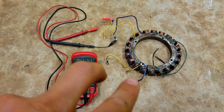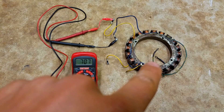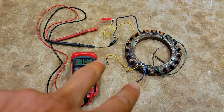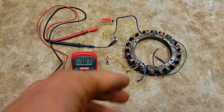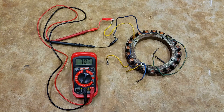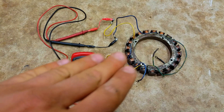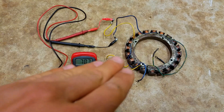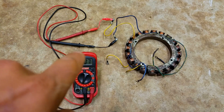Now we're going to test the other coil, and then we're going to test the charging coil with these two leads. We hook these two together and test that coil now that we know this one's good. We're going to test each part and see which ones are good and which are bad. If any of it's bad, you've got to replace the whole thing — even if only one of them's bad. If it all tests good, then it's good, but if any part of this fails, it's time to get a new stator.